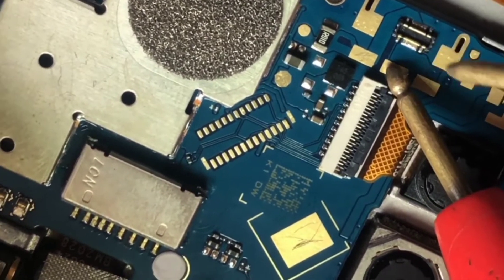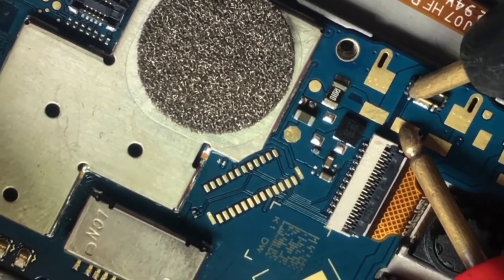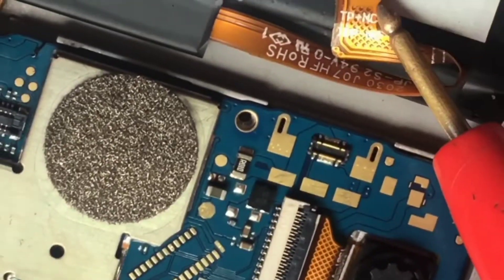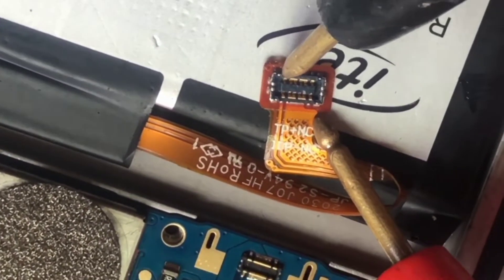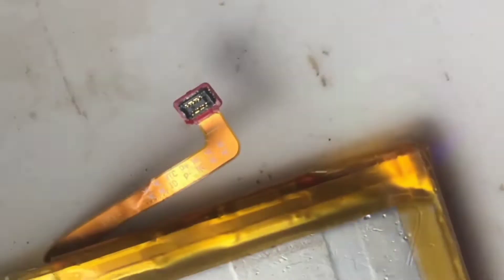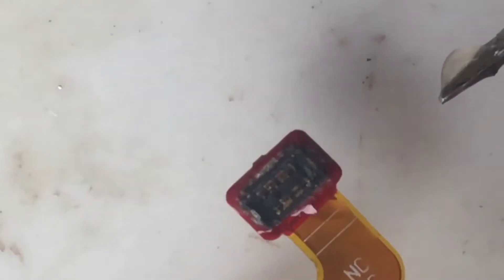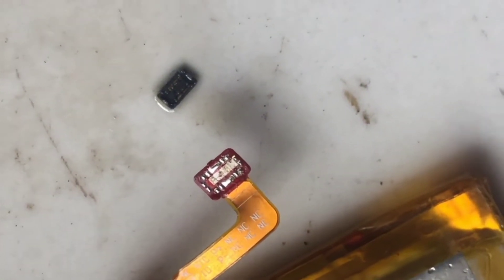To know the BSI from this terminal, you try putting it here and checking if anyone shorts with this last leg at the extreme end. From your battery, this one at the extreme is the BSI. Now, if you want to jumper, you remove this battery terminal and heat it out from the board — let me heat it out to show you something. It is out now.